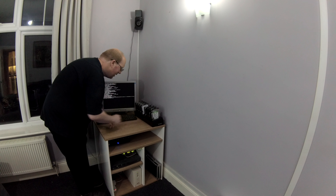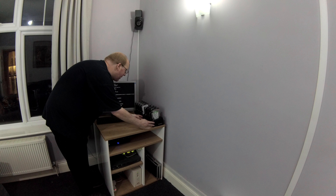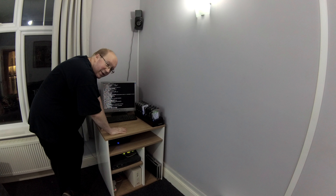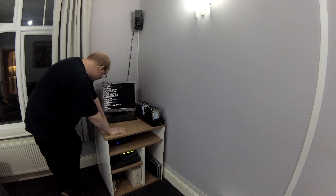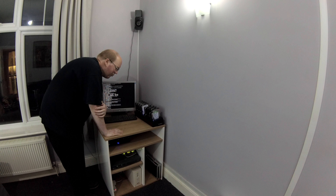Let's turn both units off. A bunch of messages on the screen about things going away. Let's just fire them up from cold and see what happens. Eight drives all about to spin up at once — that is vibrating the table quite significantly. There are definitely patterns of lights going on. SDB, SDC, SDD, SDE — we've certainly got the first four drives. The first unit's struggling a little, one of the lights is on red. This doesn't seem to be going all that well, but it might be that some of these drives are a bit dubious.